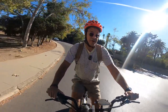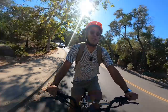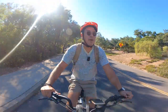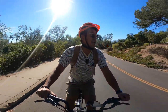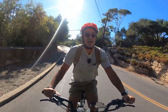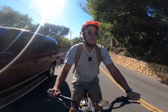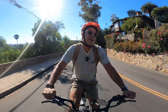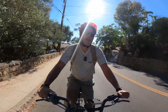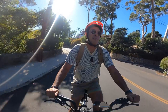There's a bit of a learning curve with this motor — really with all mid-drive motors — because mid-drive motors provide so much more torque than rear hub motors. They're more efficient because the power is coming from the crank itself, not the rear wheel. You have to be really careful with a motor this powerful. David from Brand New had this bike before me and he snapped the chain, which is really easy to do with mid-drive motors.